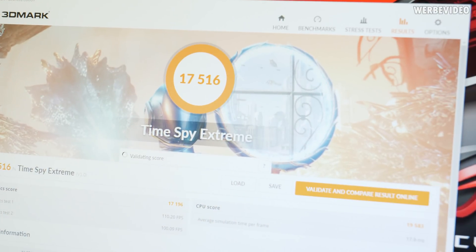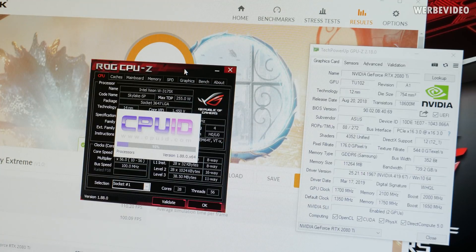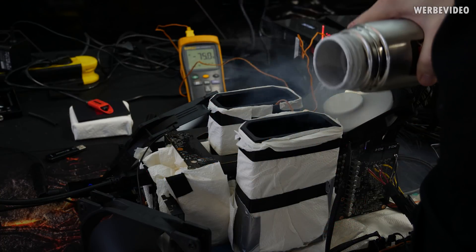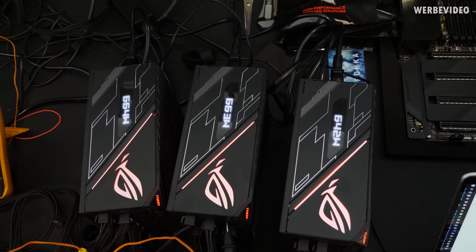We ended up starting at 2400MHz on the cards and that worked — 2400 passed and we got 17,516 points, which is higher than Steve's score. Steve, it's your turn — maybe call Kingpin or the Stephans for help. We tried 2450 which went halfway through the benchmark about 10-20 times, tried higher GPU voltage, but then got OCP and one of the cards shut down. We went really cold — minus 130 to minus 140 — and the cards didn't like that temperature. We were also running three PSUs: one for the motherboard pulling about 600W, and one each for each GPU pulling about 500-600W each, so total power consumption was around 1500-1700W.